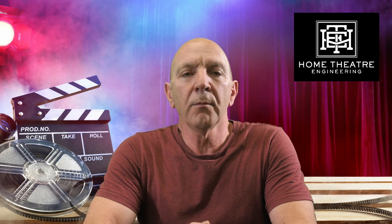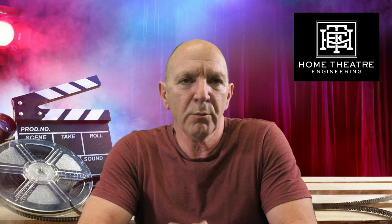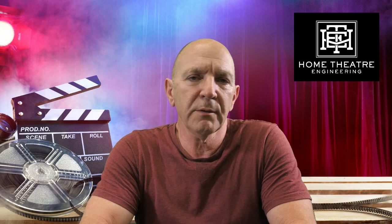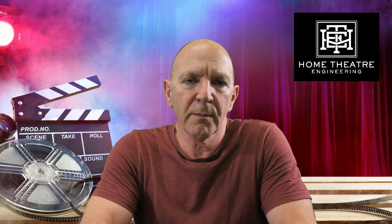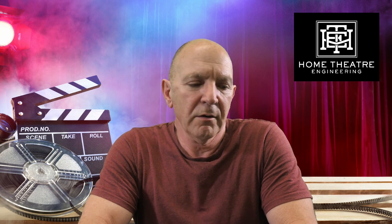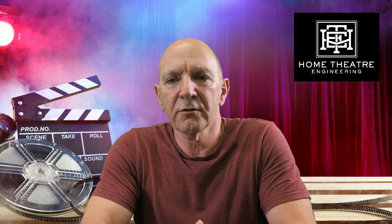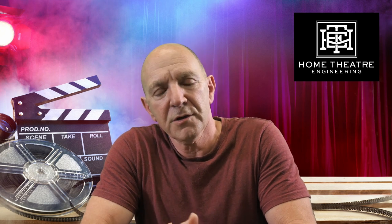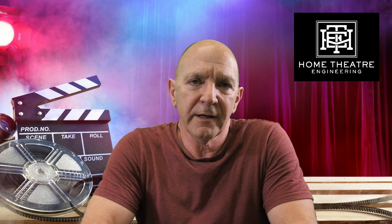That's what we do when we test our equipment. We burn in our equipment for our clients — with their permission, we unbox it, put it together in the factory here, make sure everything works, and if we can we program up the Control4 or whatever control system it is. We make sure the cables going through the device actually produce a signal and that the system turns on and off reliably. We still have issues despite all of that, but we do catch an awful lot in that process.